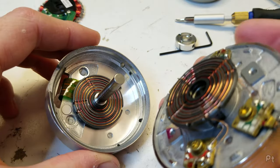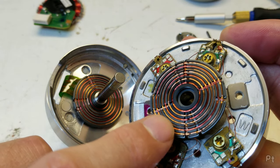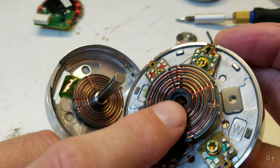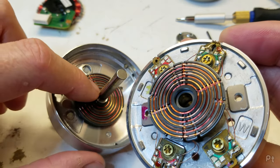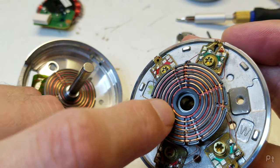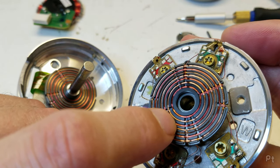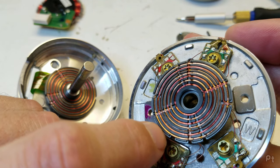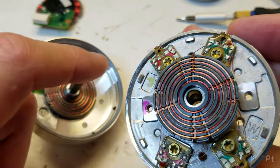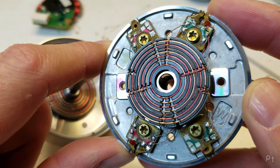We're in. So, this is the rotary transformer. This is essentially the method that transfers the signal from the heads to the VCR while it's mounted to a spinning drum. There is a winding here and then there's the corresponding winding there, and you work your way out. There's one, two, three, four, five, six — and a little one there. So you have six heads here; I'm not sure what that seventh winding would be for.